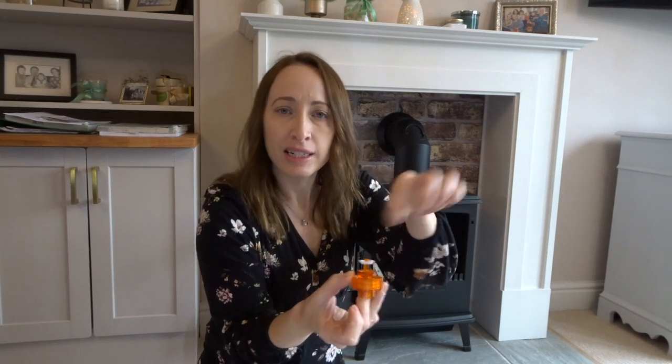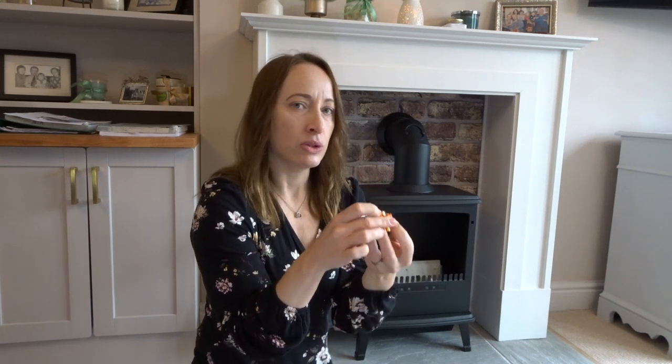It's really important to make sure that you clean around the cap really well. It's got a little spring on it, so just make sure that's depressing properly and there's nothing stuck underneath the little washer inside. I get a little toothbrush and make sure that's properly cleaned all around there and the spring. This is really important because this is what pushes down and allows the water to go down into the tank underneath. If it isn't depressing properly then you would need a new one, as the water won't go down properly and your fire is not going to work.